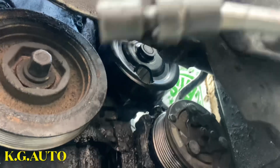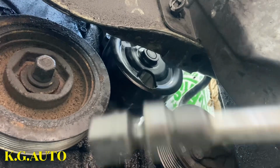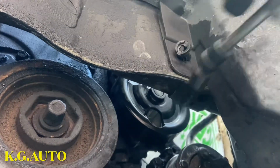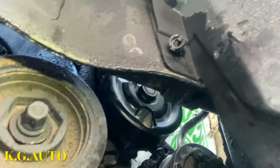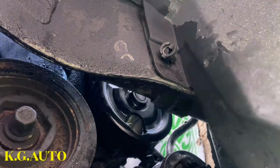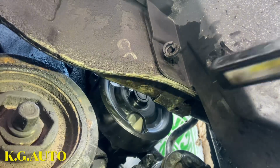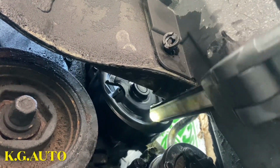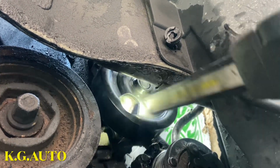So this little guy was really helpful. See, this 10 swivel was really helpful. You can go in there and maneuver your way. Everything is being tightened down now. There are 10 bolts. Just make sure you don't overtighten it so you don't break those bolts, then you end up causing a gigantic mess. When you're tightening, go vertical, go up, go down, just like that.